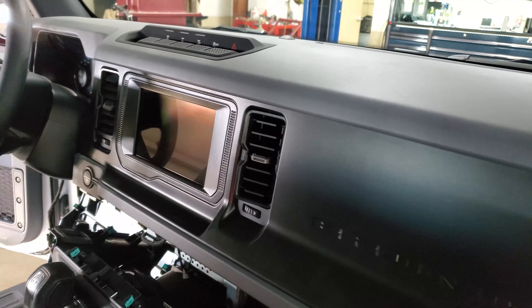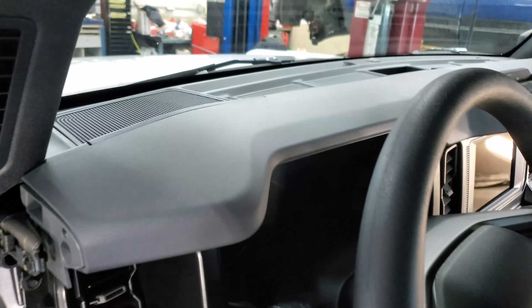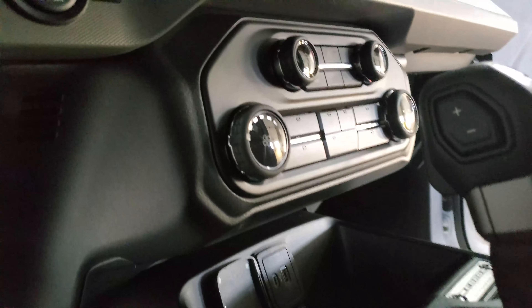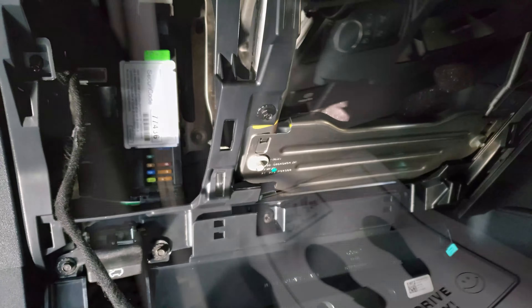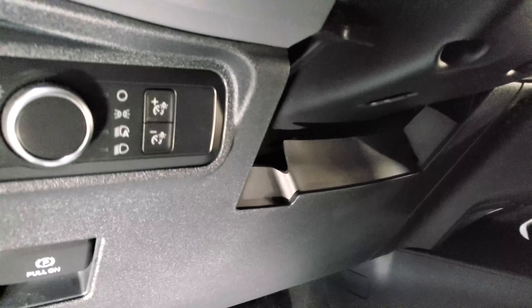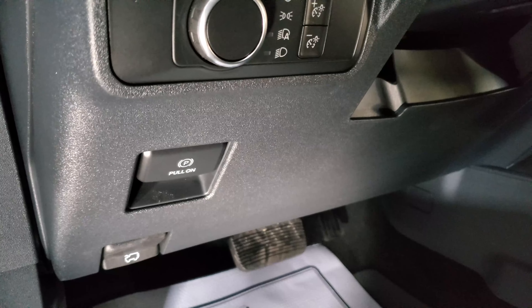Get the other side in and call it part done. With the other grill in, got the HVAC controls put back in — held in with a screw right here, and there's one on the other side inside the glove box opening. Snap this in. So this panel here just clips in — when you're going to remove that, you can just grab a hold of it in the middle, give it a good pull and it'll unclip itself. It's on hinges, it just folds down.